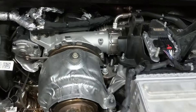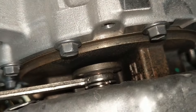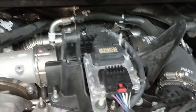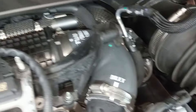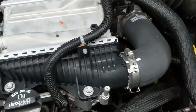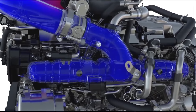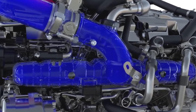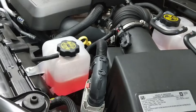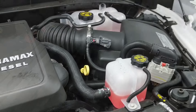On the other side you've got cool air coming in through the air box and being charged from the compressor wheel side of the turbo. That charge is varied through modular movable vanes on an actuator, which varies the charge. That air is then directed through the intercooler to be cooled and made more dense. It then goes to the intake manifold, which also has variable ports. The intercooler has its own surge or overflow tank independent of the engine one, but they share the same radiator.